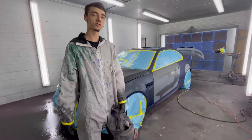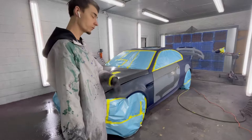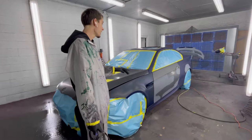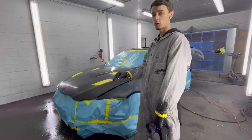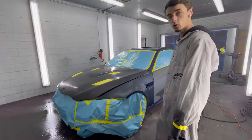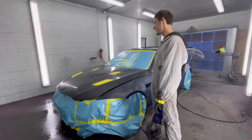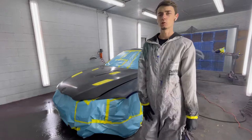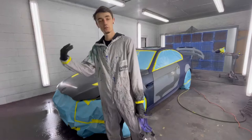We have the whole car cleaned, the booth cleaned and coated with 3M booth coating — recommended by Kyle, appreciate it. We are tacked and ready to go. We're about to cut the fan on, and after that we're going to put some sealer down — cover the whole car in a dark gray sealer. It may be a little dark but I think it'll be fine, maybe a little lighter than carbon with a bit of blue in it. It's about equivalent to the factory BMW sealer. We're using Chromex 2K urethane sealer, Imperium base coat, and then a 7-to-11 clear coat — relatively inexpensive, good solid content on the TDS. Let that sit properly, then we'll start putting our base down, then clear it. We have a car show this weekend. Super excited — let's get this car painted!